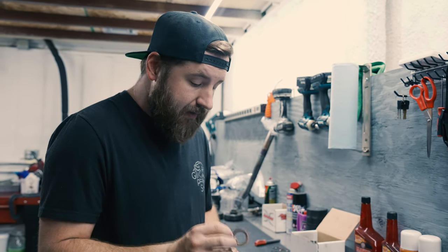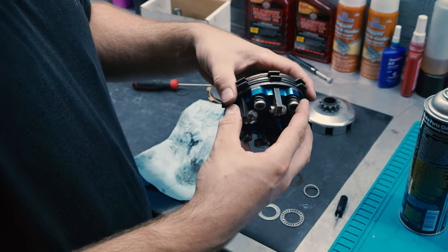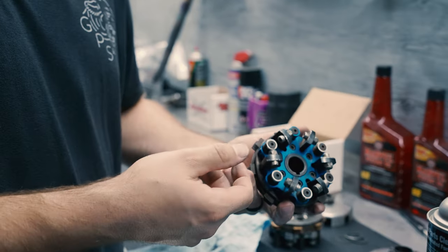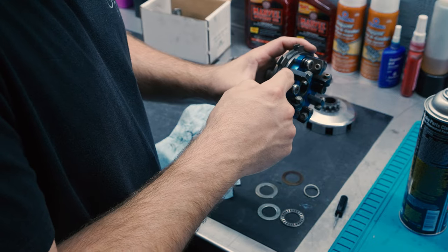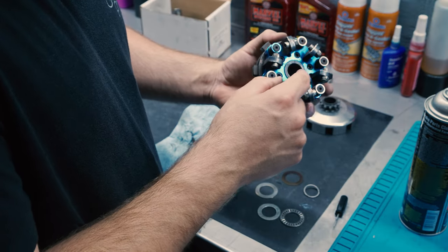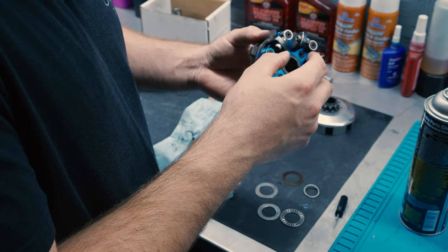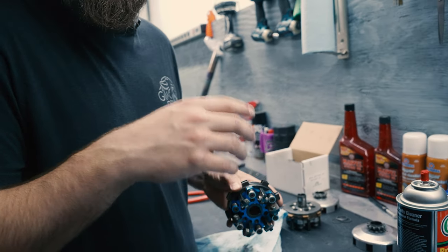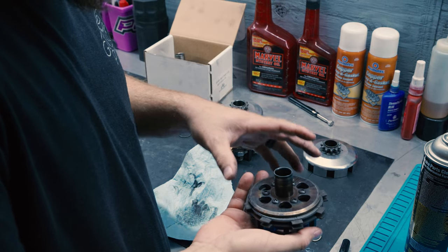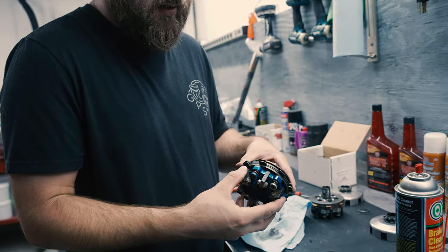For the clutch itself, whenever you're doing weekly maintenance, I normally just blow them out with compressed air. If you want to do a little bit of brake cleaner if you've got some real big gunk, focus on the moving parts and blow them out real good. Race day, if you've brake cleaned it and there might be a little rust buildup here and there, put a little bit of WD-40 on it, put it on and run it. The WD-40 burns off. I haven't ever had a problem doing it. You're not saturating the thing in WD-40 — you're just trying to loosen everything back up if you get a little bit of surface rust.